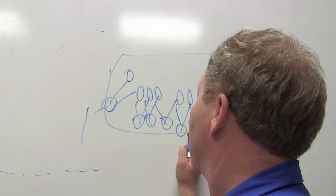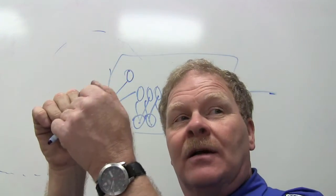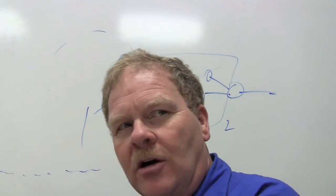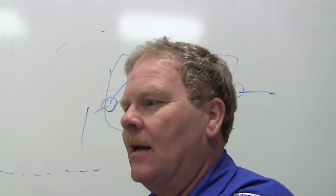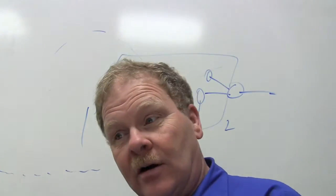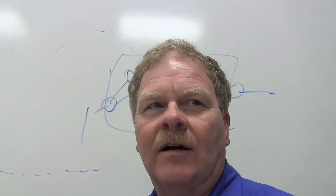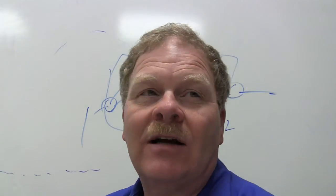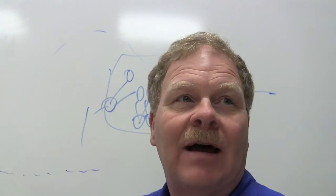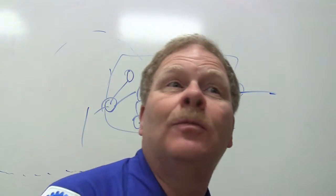That's called a three-minute battery test. You hook a small wire dipping into the electrolyte and measure with your meter — you'll read about two volts per cell. You test each cell both charging and loaded. Don't leave the charger running the whole time because the voltage will keep rising. Turn the charger on, read it, turn it off, write it down, then move to the next cell. At the dealership, I could identify a bad battery because one cell would show only 1.4 volts while the rest showed around 2.1 volts.